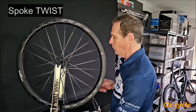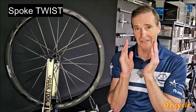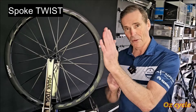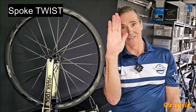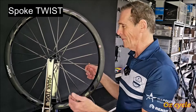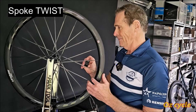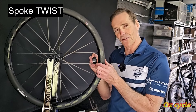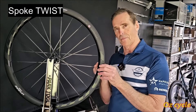Time to check spoke twist. The spokes should all be nice and flat, aligned with the direction the wind is coming from. The faster you go, the more direct the wind — the spokes need to be at knife's edge. No point having a flat aero spoke that's slightly angled; it acts like a sail and makes you go slower. Using a tool with a slot that fits onto the bladed spoke, the first spoke shows how each spoke should be, with a yellow line illustrating perfect alignment.